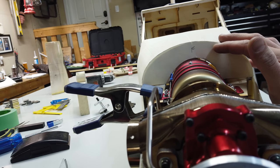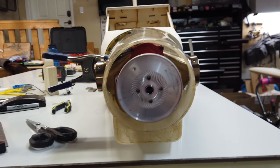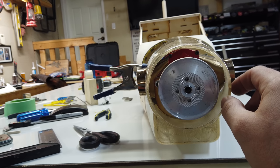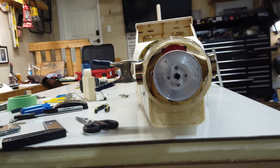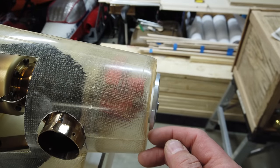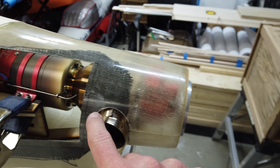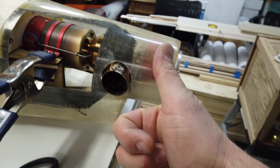I took the top part of the cowl and traced it onto paper to make a template, then slowly cut it away to get it really close to the engine. With a mock-up three-inch spinner — the real one is three and a half — we've got a half-inch gap all the way around the back plate, perfectly centered. The exhaust cone gaps are opened up just enough. Very happy with everything so far — it looks great.